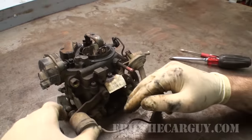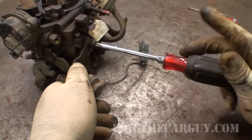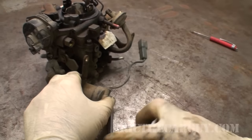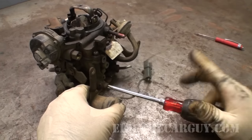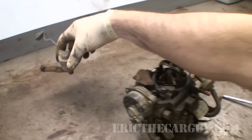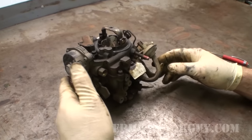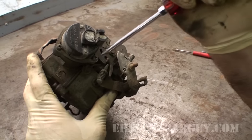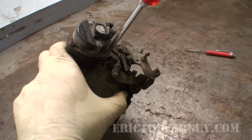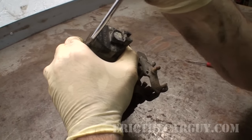I'm going to start disassembly with some of the stuff on the outside. I like to keep all my screws and parts organized — I'll keep it all as one piece. Work in a cleaner area because these are a lot of small parts and you can very easily lose stuff. This is the choke assembly that I'm going to remove now — we don't want that to go in our chemical dip. With some of these screws, if they round off on you, you can use a pair of vise grips to get them off.